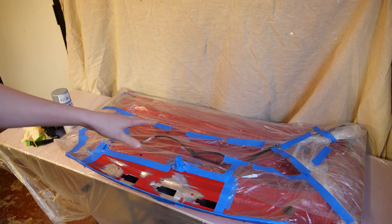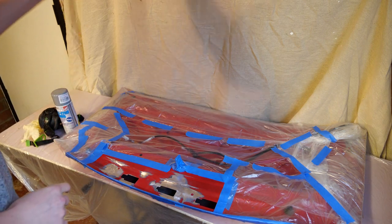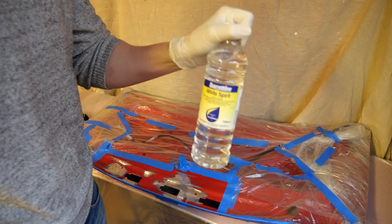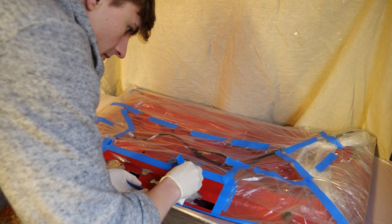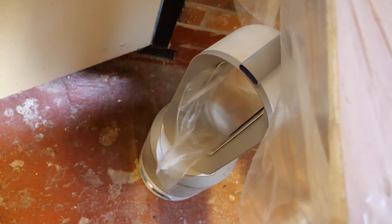I've got to clean this area and make sure there's no grease or dirt on it, and then I can get to priming. You really want a surface cleaner for this, but not having bought any alcohol, I'm going to use White Spirit. I'm using E-Tech Technic Self-Etch Primer. Aluminium is quite a difficult material to get paint to stick to, especially when using aerosol products, so it has a chemical reaction with the metal on the surface to ensure a firm bond with the paint.